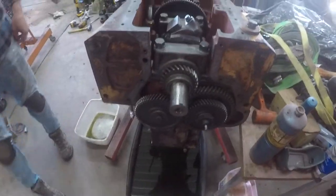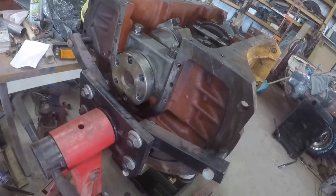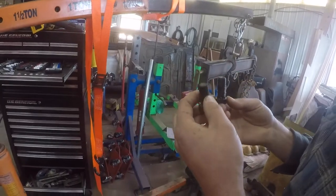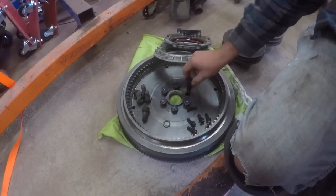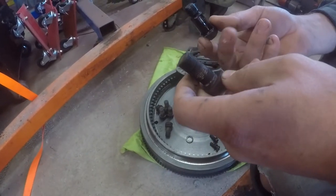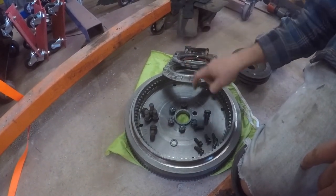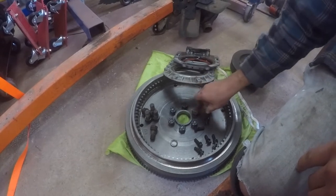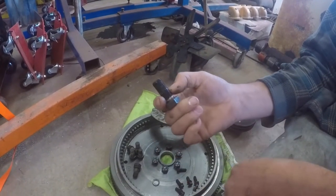There's quite a difference in these two motors, other than a few cubic inches. The cranks are supposed to be the same, but the flywheel bolts are different. This flywheel is tapped to one size larger — bigger bolt holes. You can see the difference there. Here's the bolt we need to use, here's the flywheel. It's as tight as a dowel fit. What I might do is get two bolts that have a shank to them, a neck.